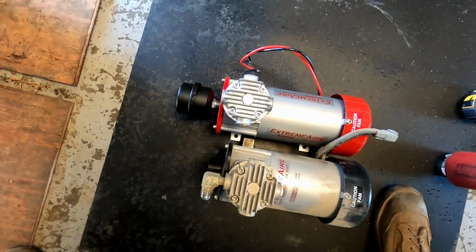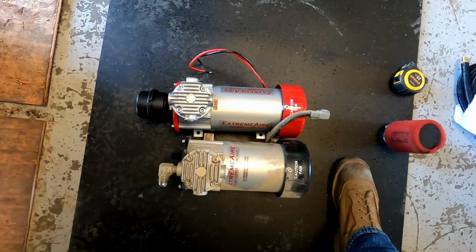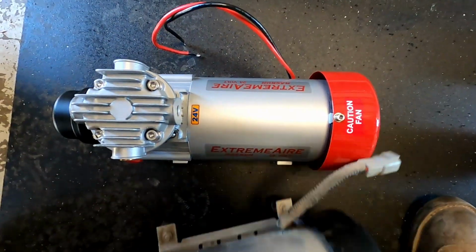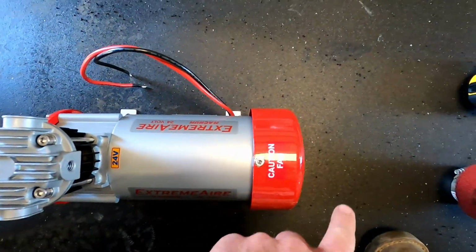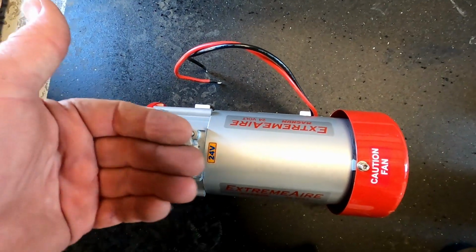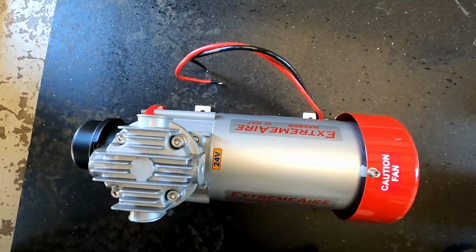So I'll pull this air filter back off of it, and then I will set it in there and just make sure it fits okay. If it does, they said to cut the horse stall matting to the same dimensions as the whole compressor unit, not just pads for under the feet, and that way that'll help to absorb some of the sound. So we'll see how that goes.